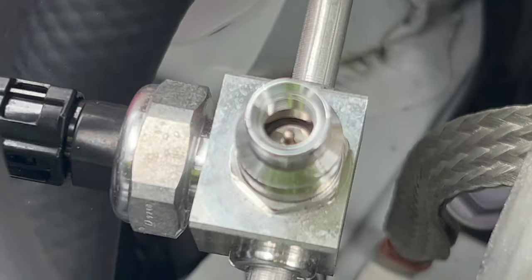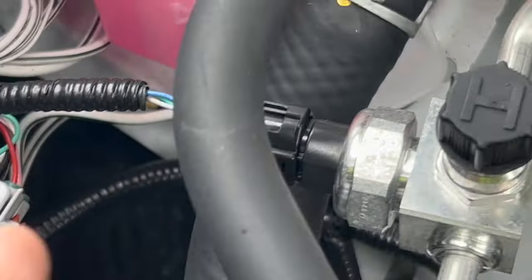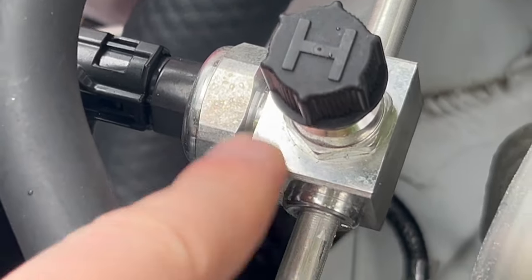This is the high side; the other one's the low side. So that's the high side port, and there's a pressure sensor — that's why there's an electric wire. There's a pressure sensor on the side of this one. Then this line actually goes down past here into the front of the car. If you followed that along, it goes all the way down into the front of the car because there's a radiator — a fin type radiator, where fluids move left to right and those vertical fins perform air-to-liquid heat exchange. That's behind the front bumper here.